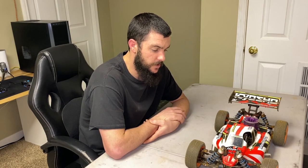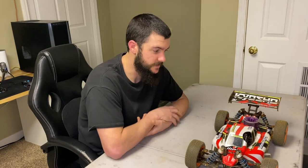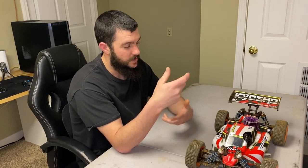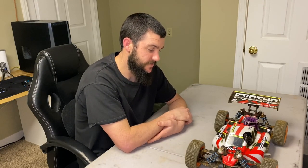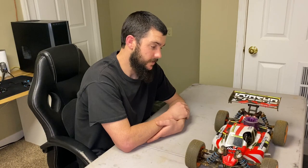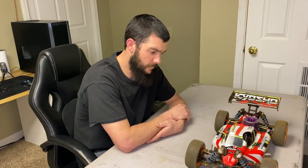That being said, I think the Kyosho motor just kind of got tired after the 2 gallons. It's a hard 2 gallons. I'm really hard on my cars. I guess who isn't, right? But it lasts about 2 gallons, and I think it lost a little bit of compression. You know, that trick where you hold the flywheel at top dead center, like mine would just pass. So I don't think there's much pinch in it left. I did run some after run oil through it and gained a little bit more compression, but I think it's a little bit tired. I think it's also had idling issues because it's developed some air leaks around the carburetor and the front main bearing. So I think it's just a little tired, and it's time to upgrade anyways. So I'll hopefully be getting a new motor here shortly.